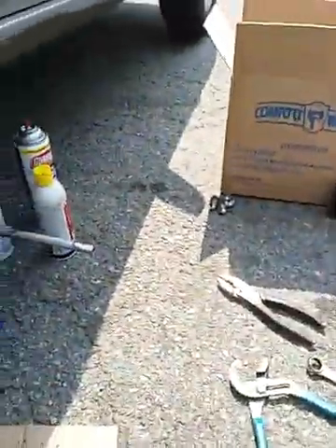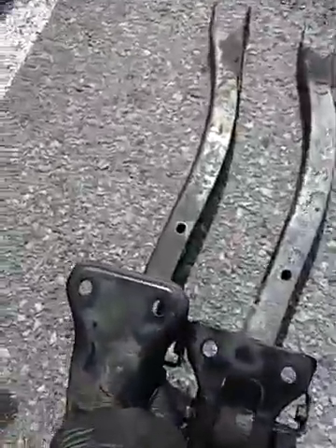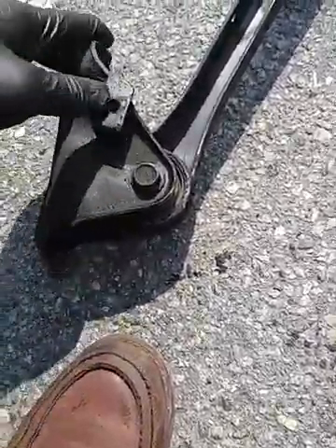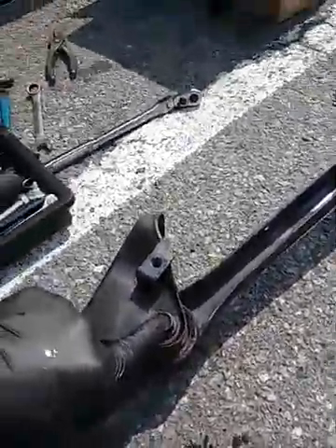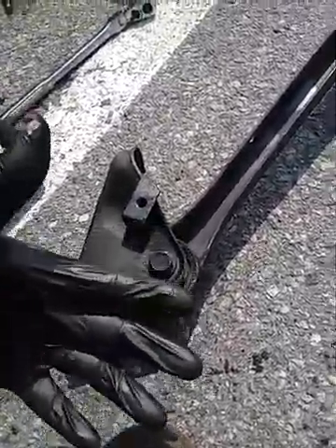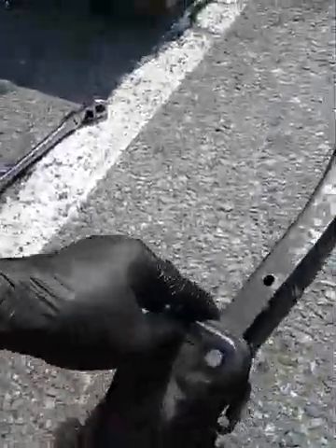The front is almost complete — the only thing I have to do is pull out the Legacy's tie rod and replace it with mine since mine is bad. I'm going to replace the rear right passenger side with the Legacy's to center my wheels and change the angle, since the struts are a lot taller than the originals. They were so old and bad that I had to replace them. Luckily, I have a donor car — my neighbor's '99 Legacy.